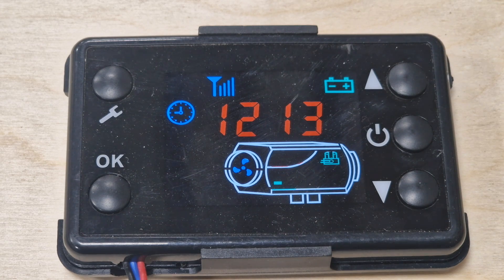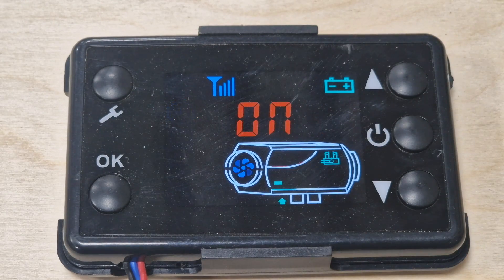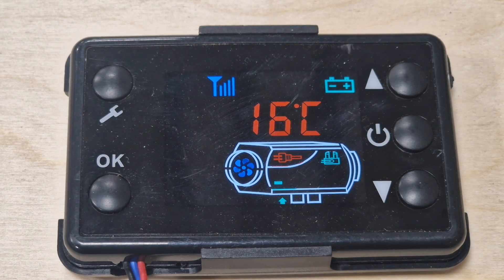You've drawn the fuel through, so now you can actually start up your machine. You want to know it works before fiddling around with all the other timers and settings. To start it's very simple — press the on button, that's it. One short press turns it on. You'll see the glow plug indicator come on, showing that the glow plug is heating. This is when it draws the most amps.